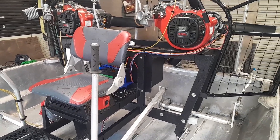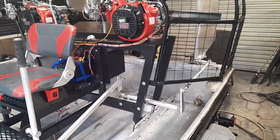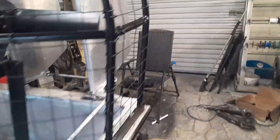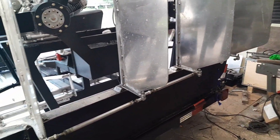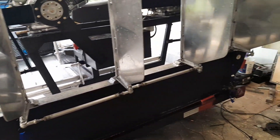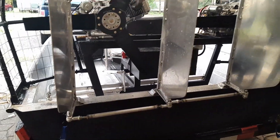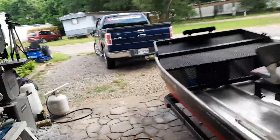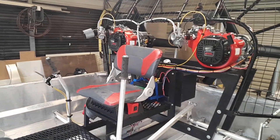So I've got to ship the props back and get some new ones — at least the blades. Move everything forward. Fix the trim tabs in the back that got all bent up from when I dropped it off the trailer. And we've got to redo these linkages between the rudders — that's just going to be cutting those pieces off and making them a little bit longer. It would probably have done good with me and Darren both in it, but me by myself — too much weight in the back, which I was kind of scared that was going to be the case.